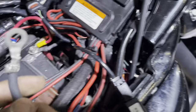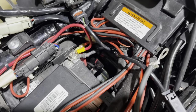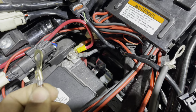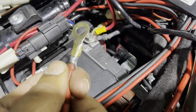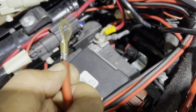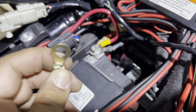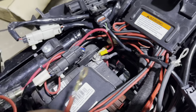That's their eight-gauge connection. Here's our eight-gauge connection — crimped and soldered. The soldering is a little sloppy because I did it quickly for this video. But notice all of our eight-gauge wire is inside the ring terminal, all of it. And since we soldered the top, it's impossible for the wire to slip out of the connector because now there's a chemical bond — it's actually welded together.